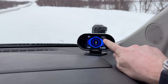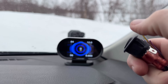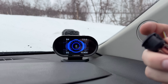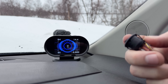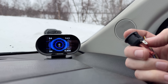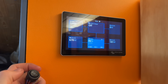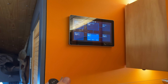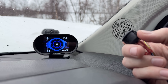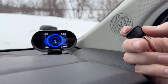Smart charging has come on — the engine's running and it's currently 12 volts because it's turned the alternator off, which means in the back my DC-DC charger has stopped. So, clicking this button in — wait five seconds — and it should turn on. There we go: smart alternator charging disabled, which should cause the charger to boot up in a minute. It took a little minute to creep up, but it went from about 650 up to 700. Let's turn the switch back off again — and it should turn off, though I'm not sure how long it takes to reactivate.